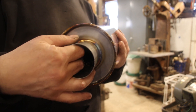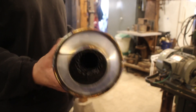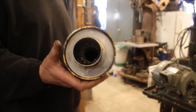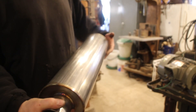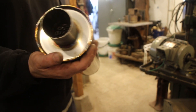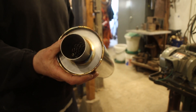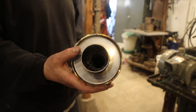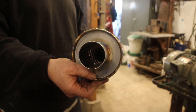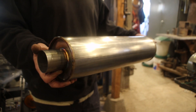It'll still sound nice but it'll really muffle it down. These are five-inch round mufflers. After the mufflers, we're going to dump it out right behind the rear wheel — not come straight out the back. I'm going to put band clamps on the mufflers, so just in case a rock comes up and smashes a muffler, you'll be able to take the band clamp off each side and replace it. If you have a 100% welded-up system, it could be a pain if something gets damaged. I know Scott's going to be running this Jeep to some remote trout streams when he retires. Anything can happen out there, but we're starting off good. This will be a lifetime muffler — we'll never have to change this.